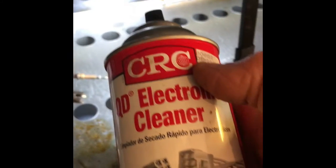This one is pretty dirty, and also it seemed like the copper wire coming into the thermocouple was loose. I pushed it in a lot more securely and I cleaned it with a wire brush and also used some electrical cleaner — the CRC electrical cleaner. You can get it at Home Depot. This stuff evaporates really fast; you don't want to get it near a flame until it's all evaporated, but by the time you get it back together it'll be fully evaporated.